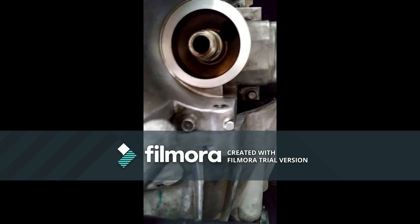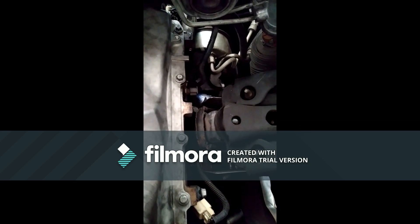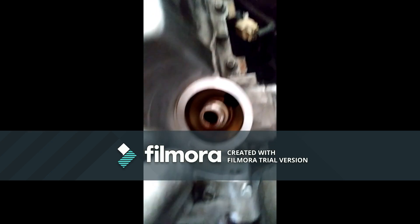I got my oil pan back on with all the bolts snug — not fully tightened yet because I want to torque them. I'll install these two back bolts hand tight first, then torque everything in a star pattern starting at the corners at 18 foot-pounds. Once all these are torqued, I'll torque the two in the back. Then I'll install my oil filter, refill with oil, and hope that everything works.